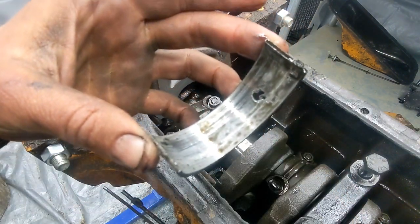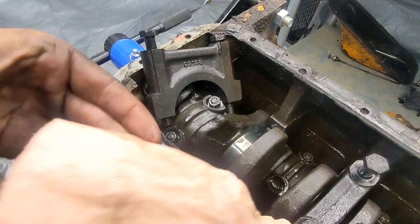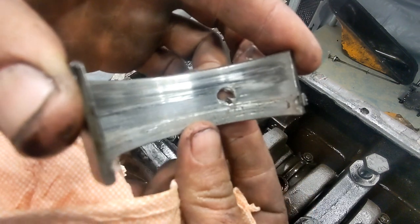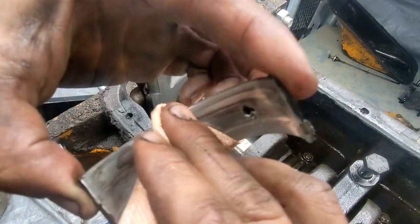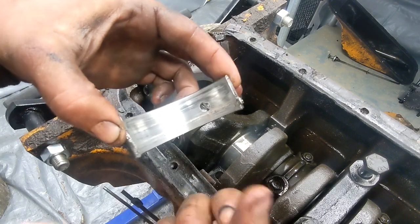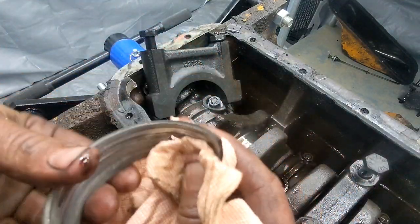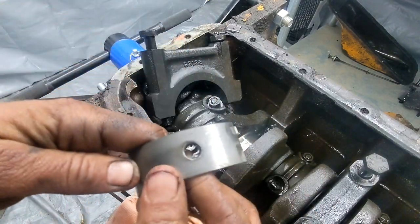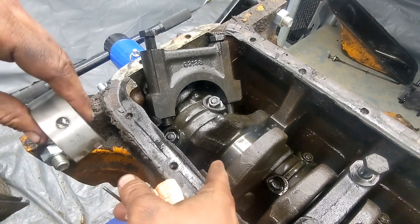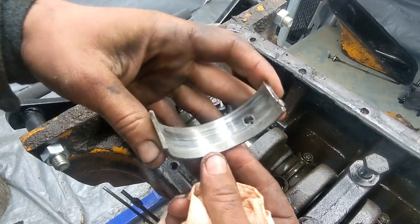Yeah, now that one - a little bit more obvious than the other ones. That dude got hot. Wow, it's got chunks out of it. Obviously you can see where it melted right there at that oil inlet hole. So this is what I was seeing in the oil pan - that was literally chunks of bearing that had slid off and gotten sucked through and landed in the bottom of the oil pan. That other side of the bearing is actually still kind of protruded out - it's slipped in there a little bit. Yeah, that's not good.